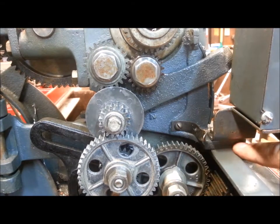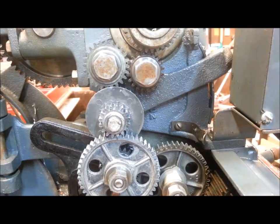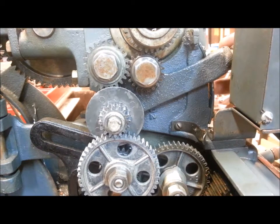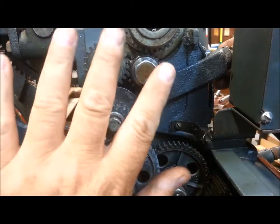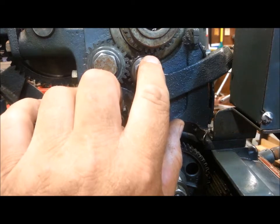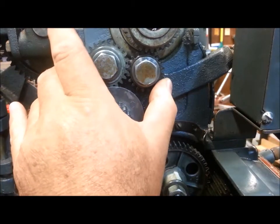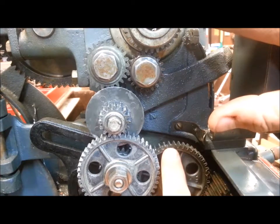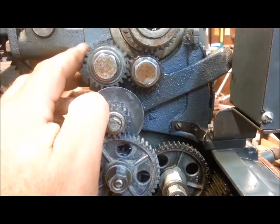I did the helicoils in here and fixed this poor attachment point, and I've adjusted the shifter lever gate — that's reverse, neutral, and forward. I've adjusted this shifter lever gate which doesn't really change the play, it just shares the play — it tilts the play so I can equalize the play between the two gears. I've gotten to studying this and discovered that the gears are quite a bit apart here. There's a lot of lash — way too much lash. Look at this: even down here this gear moves before the main shaft pinion moves, so we've got a lash problem here.